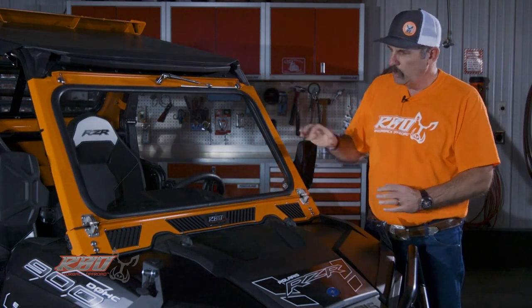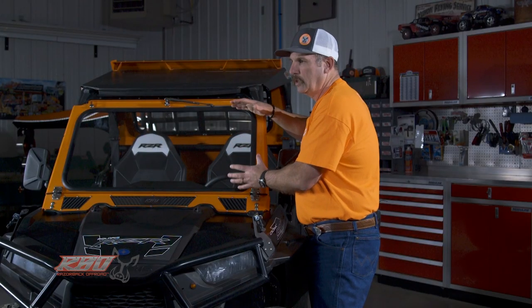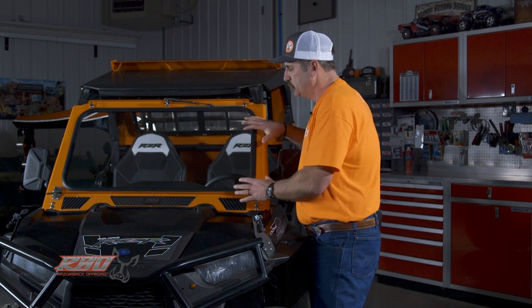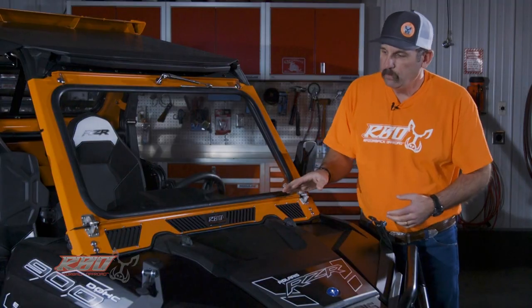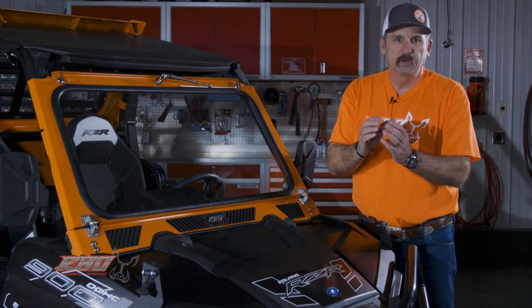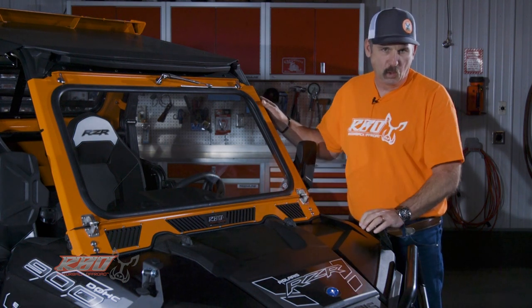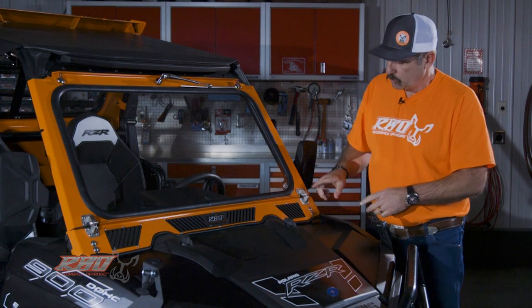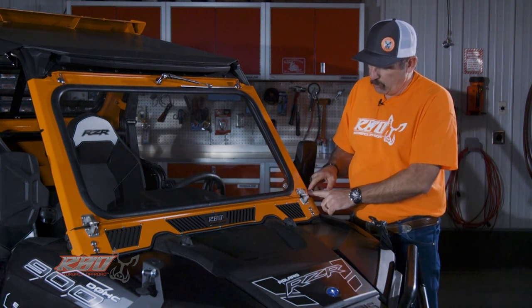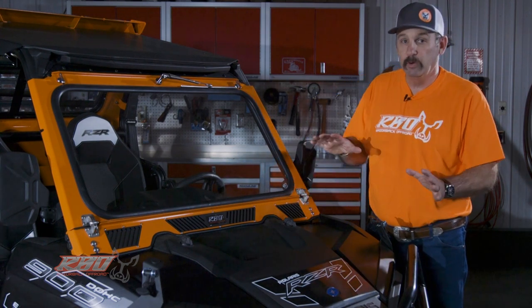The other thing that we've done is we've increased the windshield size. We wanted to give you the maximum amount of viewing area as possible. To be able to do that, we developed our own hinge system. Normally people are using a piano hinge, and over time piano hinges get rusty, galled up, and don't work very well — you go to fold your windshield and everything's just binding and crunching. So we developed this beautiful stainless steel hinge system. By doing that, we were able to get rid of the center piano hinge and increase the windshield area, which is very important when you're off-roading.